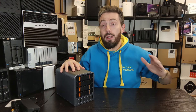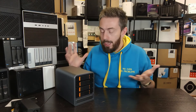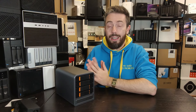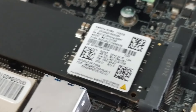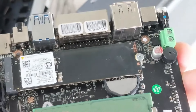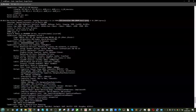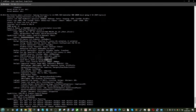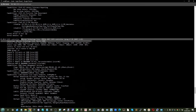We found that the SSD this arrived with had Open Media Vault already on board — it wasn't a system that arrived with Windows 11 like so many of these mini systems do. That M.2 SSD inside is a Samsung PM991A, which is DRAM-less — we confirmed that both by opening it up and by putting Unraid on it and checking the PCIe lanes. The first thing we noticed was the M.2 NVMe slot is Gen 3x2, which was a little disheartening. We also found the SATA controller is the JMB58X, handling those individual drives, and the internal layout was fairly standard.